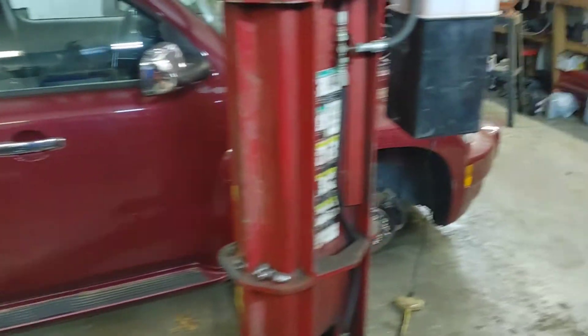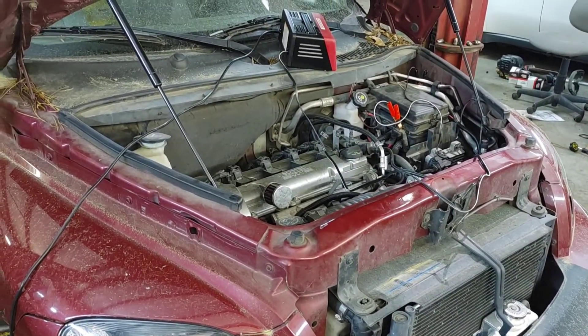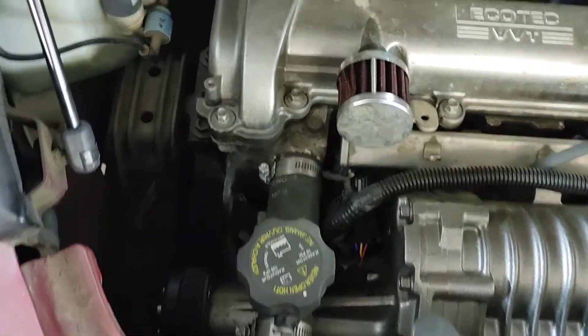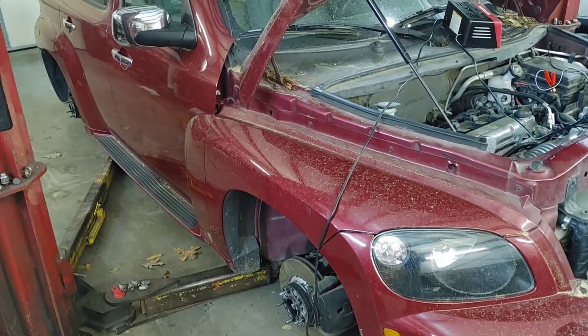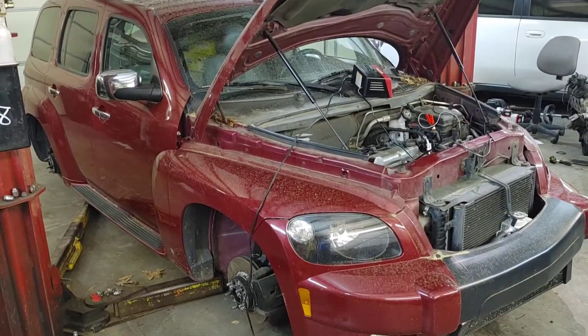On the HHR, I'm doing a few things and I'll do a full parts breakdown video since I get requests for it often. This time around I'm pulling the coilovers off because they ride like crap. I'm going back to either the two-inch drop springs from ZZP or just the factory FE3 springs — not 100% sure yet on that.